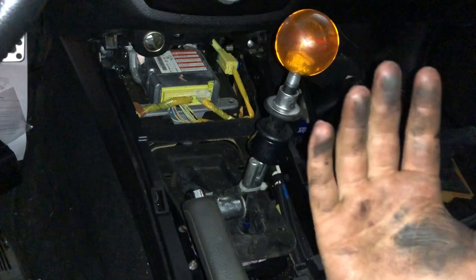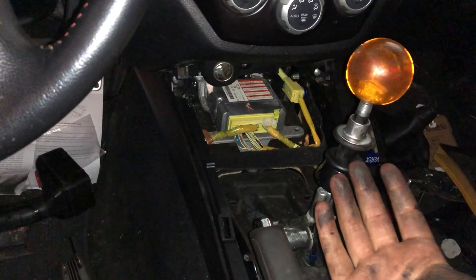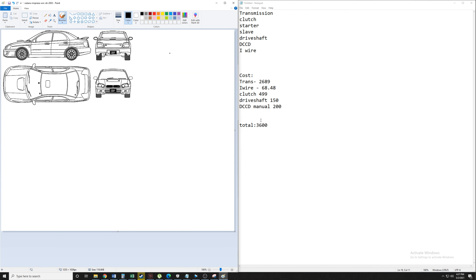This is exactly what you need if you want to do it the cheap way, which didn't involve replacing my rear differential, brakes, hubs, or axles — it just swapped right in. One thing to keep in mind: the pinion flange on the R160 does not fit an STI axle. In order to make the R160 work, you need to get a flange for an R180.